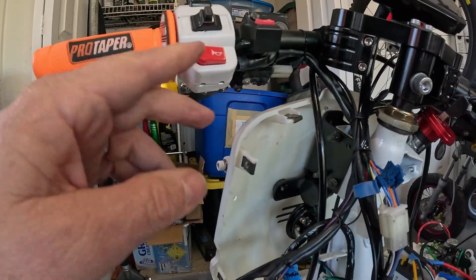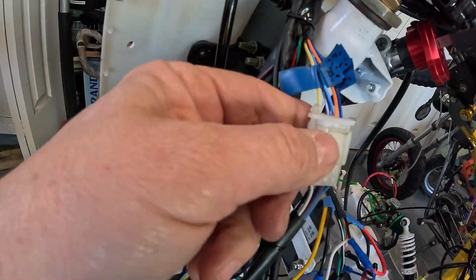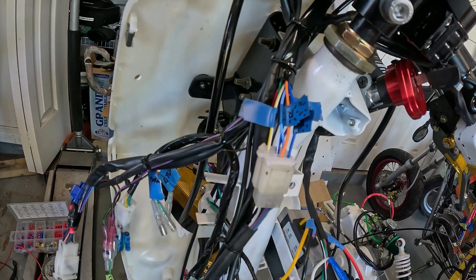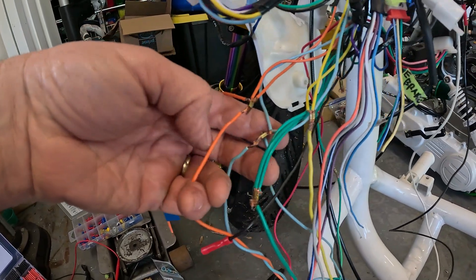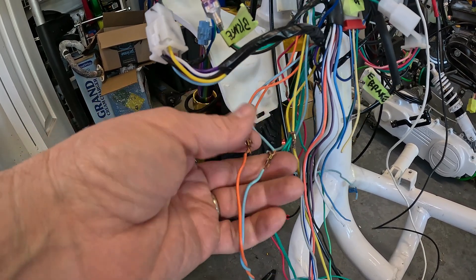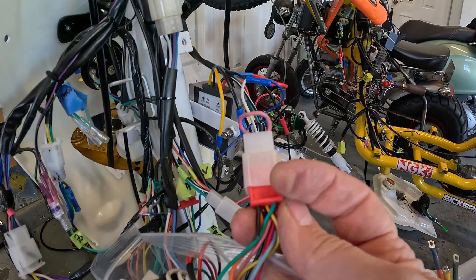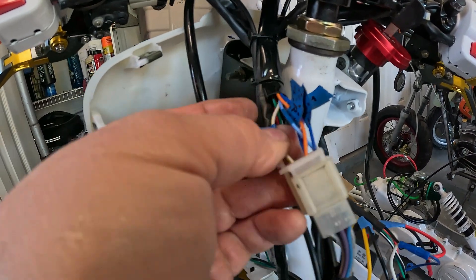Now the colors don't match of course, so I have to be careful and do it by pin position. Another one you're gonna have is your left blinker and your right blinker - they're gonna be orange and light blue, and just like most Chinese bikes they're actually that color in real life. So if you look at your blinkers, this is where it sends the orange wire back and the light blue wire back. There's a whole bundle together - we can go front blinker, left blinker, and the original indicator. A real easy access point: if you remember that one that has a loop in it with an orange and a light blue, they're going nowhere - that's a dead end plug. So you can just tap in your light blue and your orange wires and feed those into your display so you have turn signals.